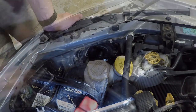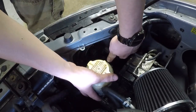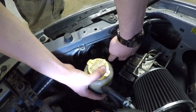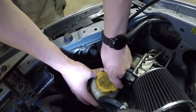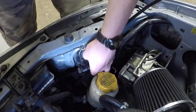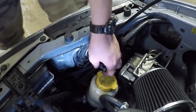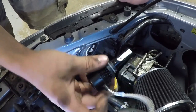On this side we have to remove the power steering fluid reservoir, which is very easy — just push the tab in and pull it up. You don't have to remove the hoses, just move the reservoir over a little bit. Actually it might be easier to remove the bulb first and then the wire. There we go — pop in the super bright new LED light.